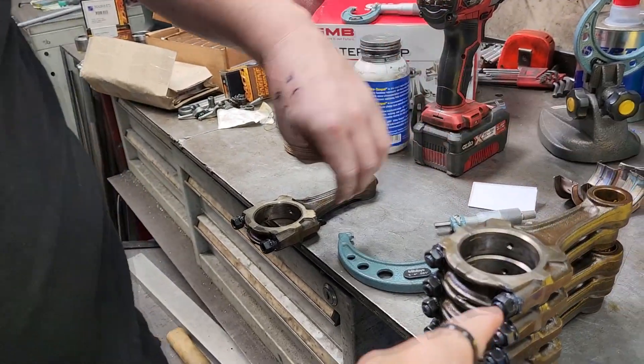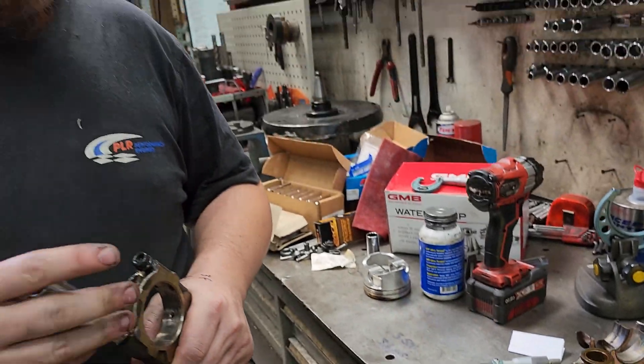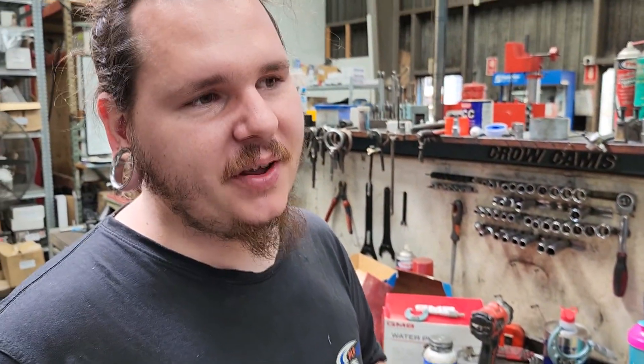How come we're putting nuts on these now when there's supposed to be a crank in the middle of that? We've got to resize them. The different tension of the ARP bolts distorts the shape of the rod tunnels, so they have to be resized. It strips them off the mating face and we've got to hone it on that machine back to spec, then check bearing clearance.